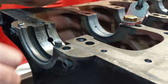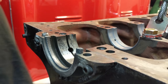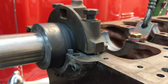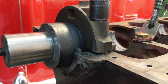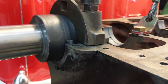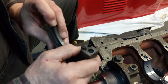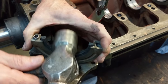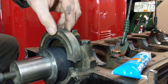What we'll do is bolt the main cap on and take the tool in the lower half to see how it fits - then we can cut it off once we see the proper size. We're going to pre-size just one half and see about the cut we have to make, because I think the manual instructions assume a rope seal that's already a perfect dimension, but that's not what we've been provided here. Fitting the rope seal into the other half of the cap - this can actually be put on the wrong way around, and the last one we took apart, it was reversed.